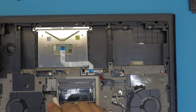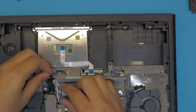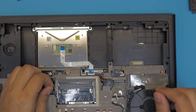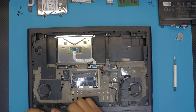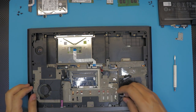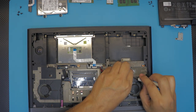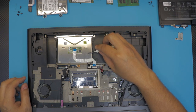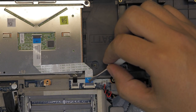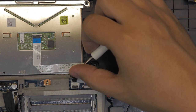Remove the bracket that holds the LCD cable on the board by removing one screw, then grab this plastic piece and pull it straight up. Next, loosen up the cables — there's an adhesive tape there. Also remove this cable which I'm guessing is for the webcam. Next, loosen the backlight cable and the trackpad by lifting up these hinges to 90 degrees, then gently pull out the cables.